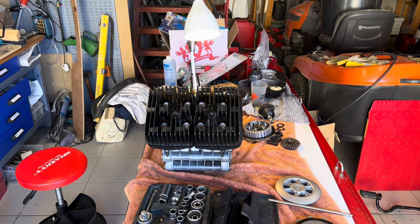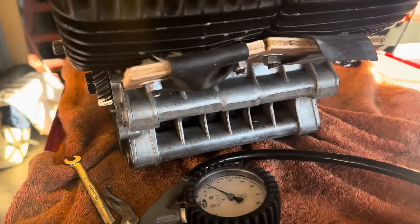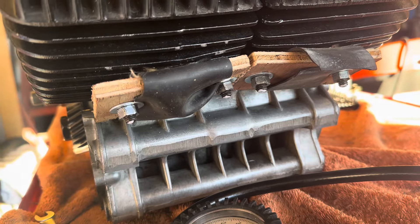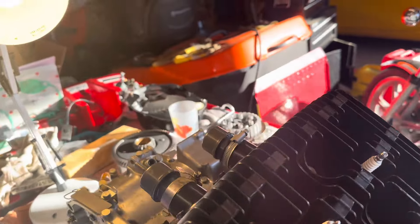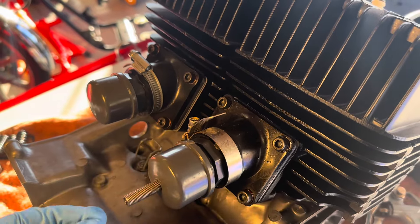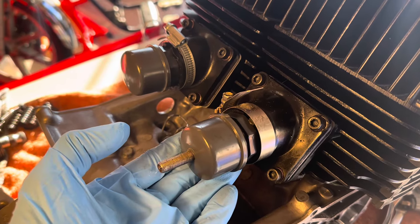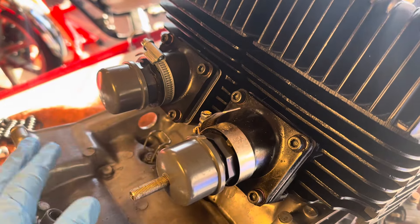It's got that nice bop sound as the pistons go up and down now. So we're now set up for a leak down test — I've blocked the exhaust ports off with some plywood and some old inner tube, there's a set of spark plugs in it, and on this side I've made a contraption to get compressed air into the cylinders.